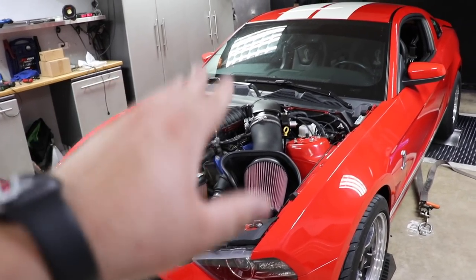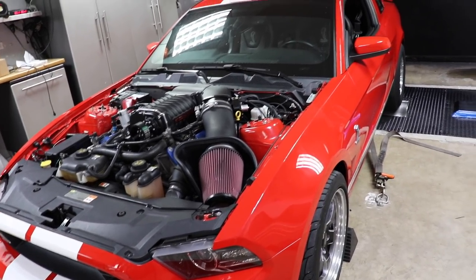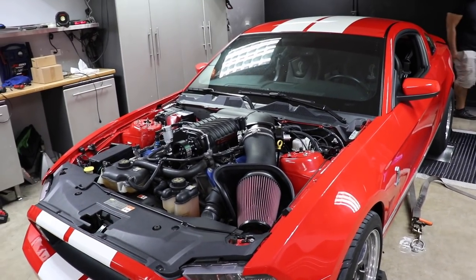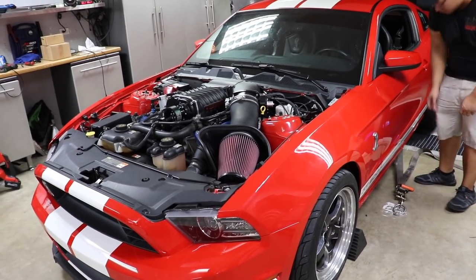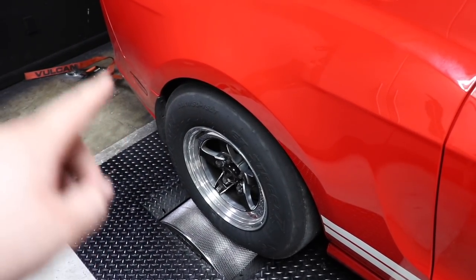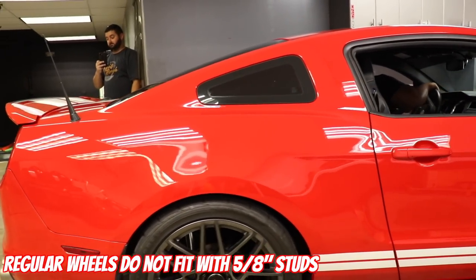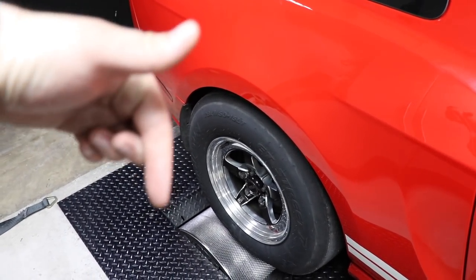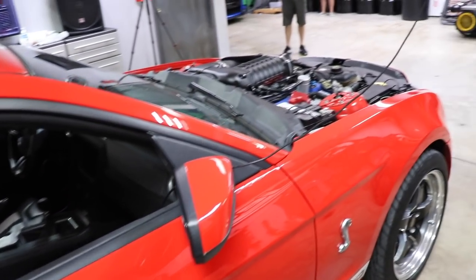I'm super excited to see what it is. Whipple 150 millimeter throttle body, 10% lower pulley, fully built 5.8. We've got a Mantic triple disc and a lot more stuff to list, but that is the basic rundown. I'll have a list down in the description of everything done to this car. We're on pump E85. One important change to note is that we do not have a street tire on here. Last time we dynoed we had a street tire. We do have an ET Street R bias ply — a very soft tire. We might see somewhere around 40-50 wheel horsepower less, so in our comparisons we just got to keep it in mind. We should be good to go with this big old Whipple on here.